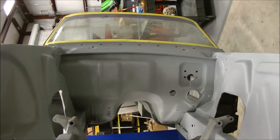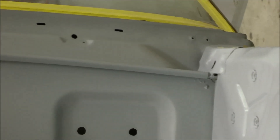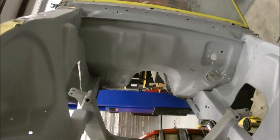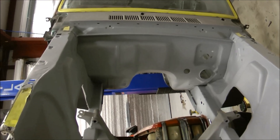I said we would wait until the next video, but I went ahead and tackled it. That whole lip has been replaced with a fresh piece of metal. I cut the old lip way back but left enough that the pinch welds from the factory were still in place. Got it nice and straight, so it looks great — she's looking really good.